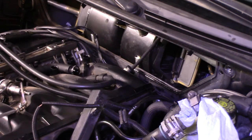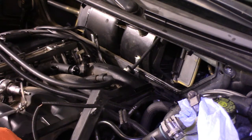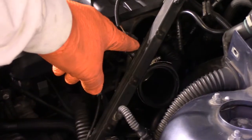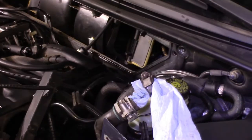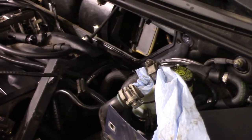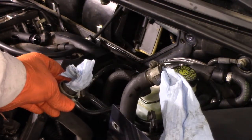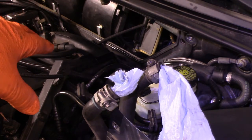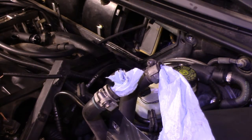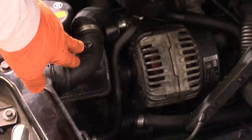It's not a great video on how to take everything apart and get to this point, but if you're back there working on that: if you take the plenum off it gives you more room, and if you take the electronic controls for your fuel injectors and pull it to the side it gives you a little more room. But what you finally have to do — there's just no way around it — you've got to disconnect your heater hoses. You don't have to drain your complete coolant system like the books will say. Just put a rag underneath, you're going to lose a little bit of coolant, and then pull the hoses up so they're above your coolant level in your reservoir.